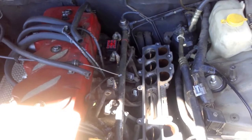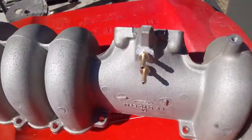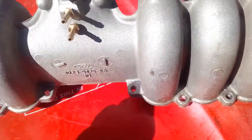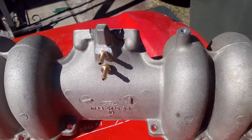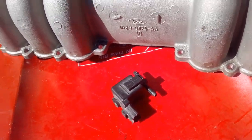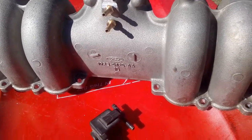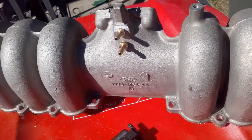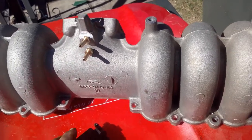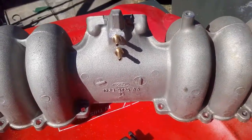So this is what I've got to counteract that. Here's another manifold I prepared earlier — we've tapped some threads in here. This is to bleed off: I've got this valve here, it's part of the evac system. You can hook up a micro switch to the throttle, and on idle I can basically bleed off so that it's running a bit leaner instead of being rich. A rich condition makes it very doughy on takeoff. They do work better slightly lean.